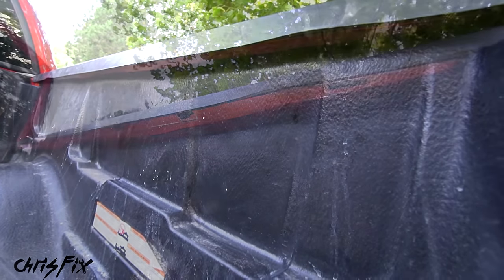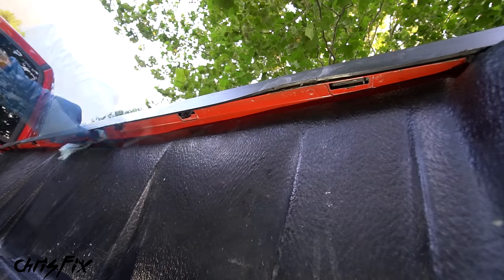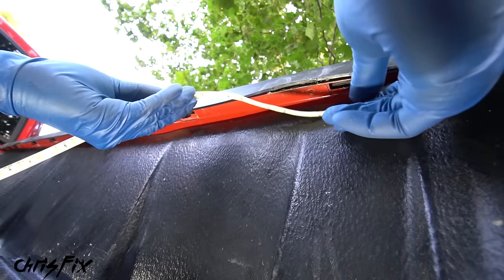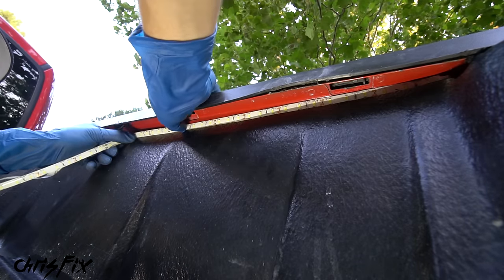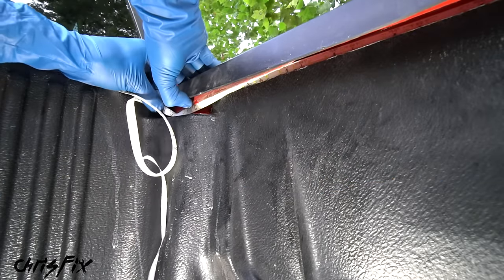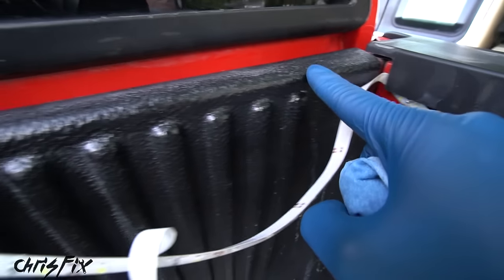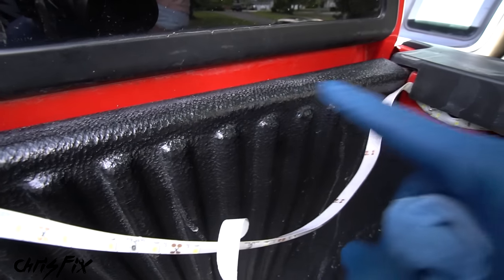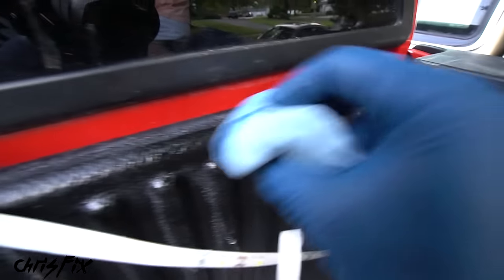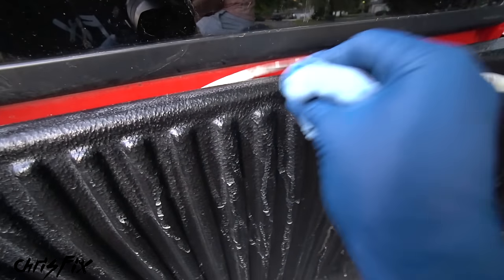Before you attach the lights, it's very important to get isopropyl alcohol and clean the surface you're applying the lights to — if you don't clean the surface the lights will not stick, so don't skip this step. Now we peel off the cover from the double-sided tape and stick the lights where we want them to go, pressing down with decent pressure so it adheres completely. Coming to the corner, I'll tuck the lights right behind this plastic bed cover so it doesn't budge. The plastic bed liner section is textured and a little oily, so clean it really well — the double-sided tape included might not stick.